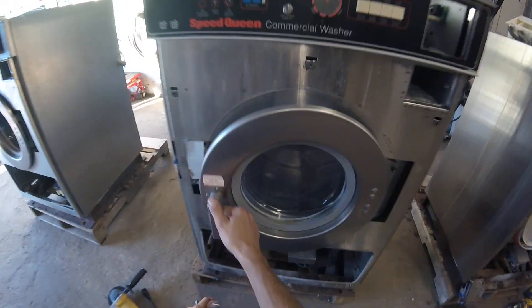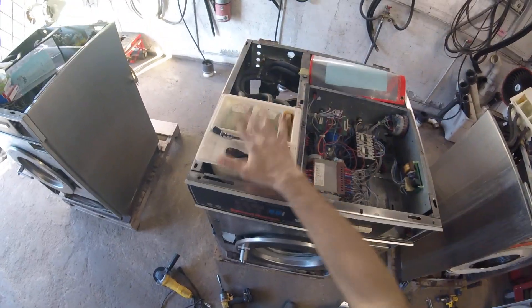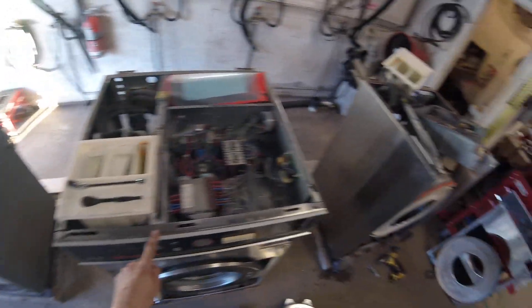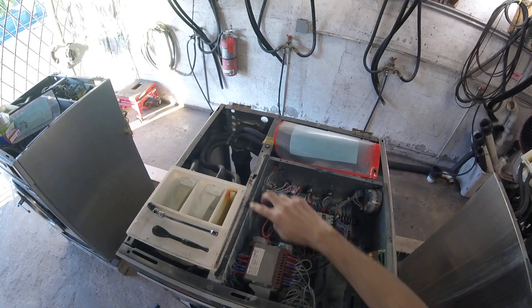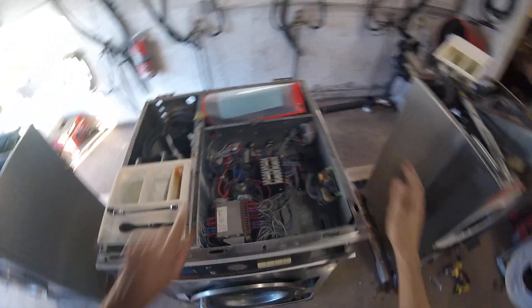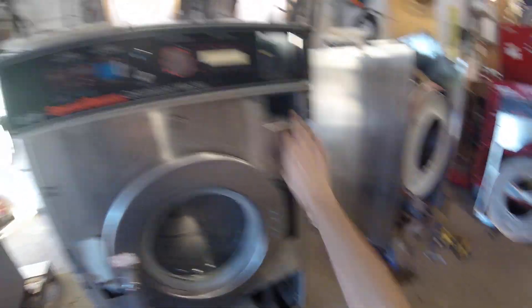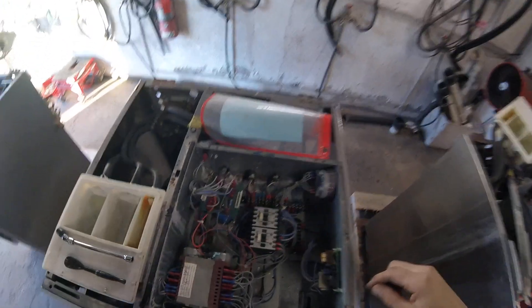With your door off and these two cut, you're gonna want to come up top. You're gonna have to remove the soap dish — just detach the hose clamp from underneath and fold it back. The T20 bit here will take out this screw; there's one here and one here to hold the control tray in place. And you're gonna have to loosen and remove this 7/16th nut to get the nut off and the control tray loose.